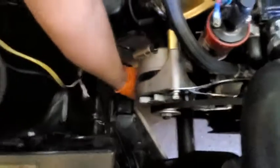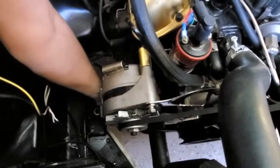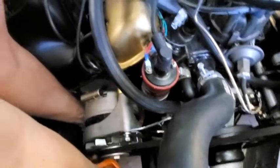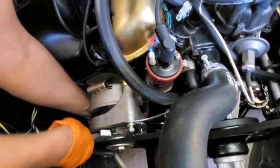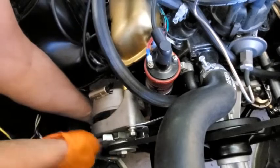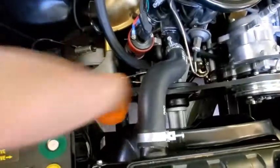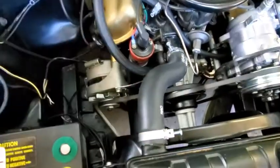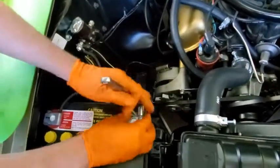Get the belt on. Usually I can get enough tension on the belt just by putting my arm underneath and holding it as tight as I can while I tighten the bottom bolt. If you want to put a pry bar in there you can, but I don't want to put a pry bar anywhere near such a nice car. Good tight tension on that belt — that's tight. Get our battery back up. Okay, alternator's back on.